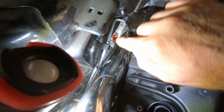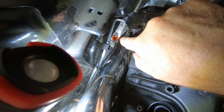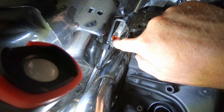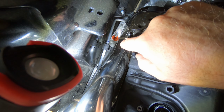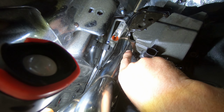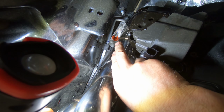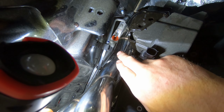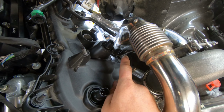Once I pulled the harness out of this little area here, and now it's laying up here, that AC block, I was able to just kind of force it over, kind of lightly tweak the tubing for the AC, and there's a small gap between the actual turbo pipe here, downpipe, and the block. And of course there's a little bit more room for the engine as well, so the engine is able to shift over. This allows for a slight increase in room on this side.